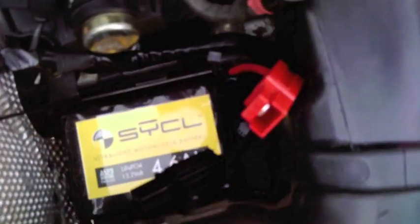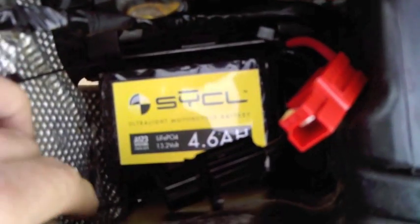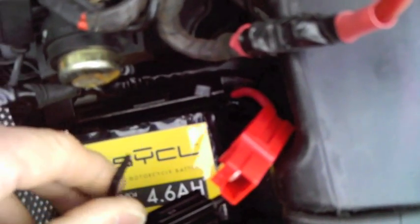You should pre-plan your wiring so that it's out of the way, and then go ahead and place the battery. The battery doesn't need any kind of foam padding as long as you have it firmly positioned so it doesn't move. Now that it's sitting in its correct location, I'm going to tighten these zip ties — you want these to be absolutely tight so that there's no movement of the battery when the motorcycle is moving.